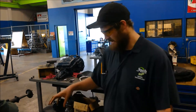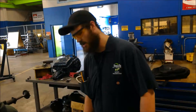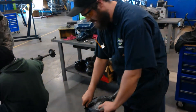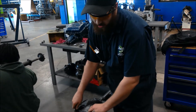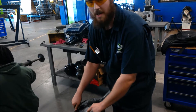Scott Colger here at JTEC. Today we have a differential. We're going to be taking the cover off and taking some measurements. We're going to measure the ring gear's runout, and then we're going to check the inch pounds of torque that it takes to make it all spin.